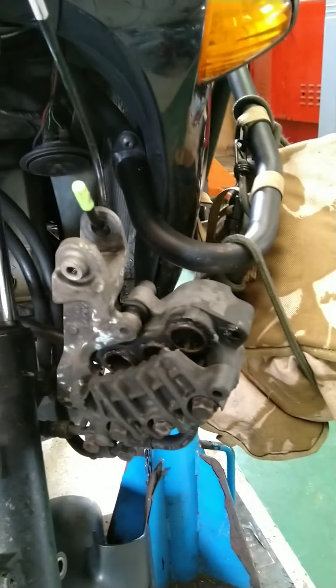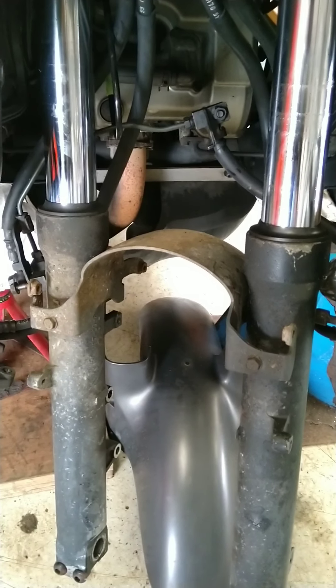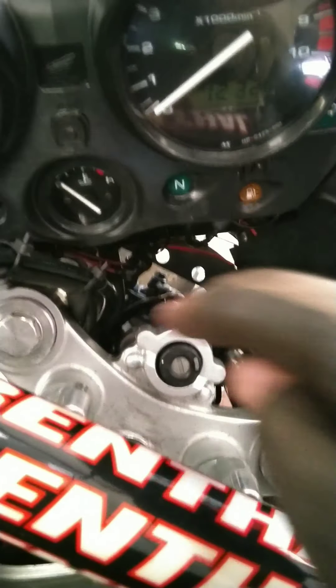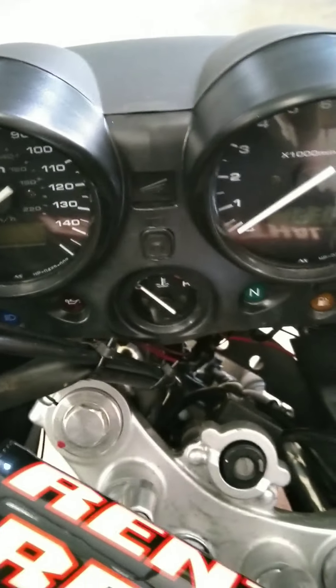I've done 2,000 miles in the space of 10 days on mine. The mudguard is just held on by a couple of bolts on the back that bolt on at the fork stanchions. Now what we'll have to do before anything else is just loosen the top bolt — we're gonna crack the top bolt there while it's still in the yoke, before we do anything. It makes life a lot easier.